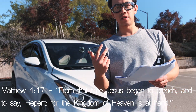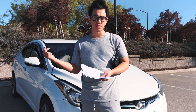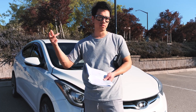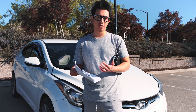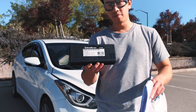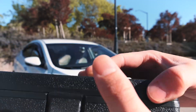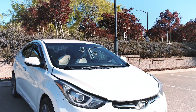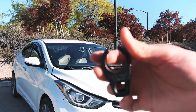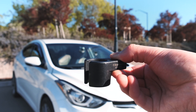Now the sensor — there are two versions of the NTK sensor: the M12 and M18. Those torque specs apply basically to the M12 size. The designation between M12 and M18 is the O2 sensor material that picks up the spent gases and sends that data back — one's zirconium and one's something else. We're pretty sure we have the M12. We're going to follow Hyundai manufacturer torque specs and do 30 as a nice middle ground. You also want to check out the 67-060 kit from O'Reilly's — it's the Oxygen Sensor Socket Set and should be universal. All oxygen sensors come in a 7/8-inch socket or 22 millimeters metric.